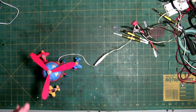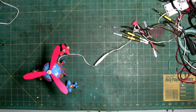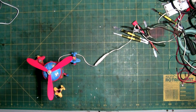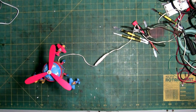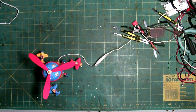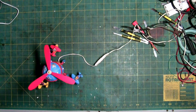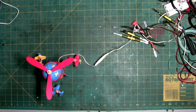But that's it. If you think you're going to pull the shaft back out and possibly have to tear it all apart again, you can put a dab of super glue on the splines of the metal shaft, push it into the gear. That'll prevent you from just yanking it out, because you just glue the gear on. So that's something you can do. But the flip side of that is, if that gear breaks, it's going to make it really hard for you to get the gear off. So it's one of those, half dozen, six the other. Although if it is broken, you can just break the gear off and then clean the shaft and then press it into a new gear. So you do have that if that gear breaks. But let's see what this thing looks like in low light.